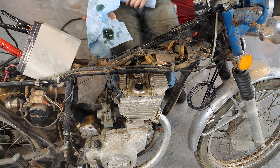My favorite is Hardman Double Bubble Epoxy. This stuff is awesome. If any of you were in the service, I apologize for the PTSD flashback you just had after seeing this for the first time in 10 years. This was the only epoxy we were allowed to use on helicopters, and this stuff does an excellent job. Each one of these little packs is about a dollar, so they might seem a little spendy, but if you do the math, that's actually cheaper than a couple sticks of JB Weld, because there's a lot more epoxy in here, and it's just a lot better.